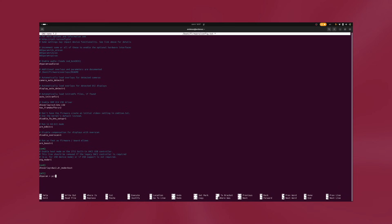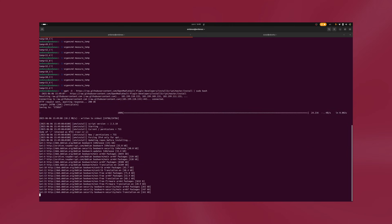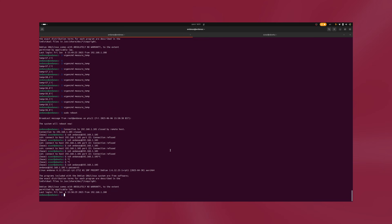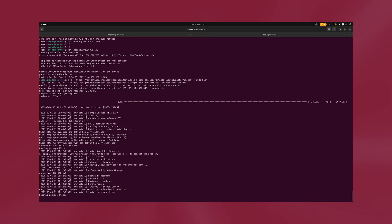Go to boot/firmware/config and write the required line into it to enable the PCIe slot. Save and reboot, and then you'll see that for every single disk you've inserted, there is a single blue LED that will light up. After that, there are two commands you'll use to install OpenMediaVault, which will handle file systems, RAID, SMB connections, users, and so on. Just make sure you reboot after the pre-install command before running the install command.